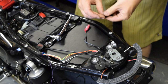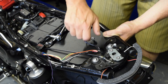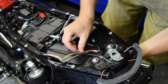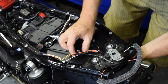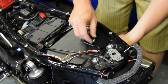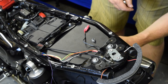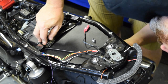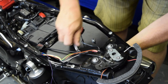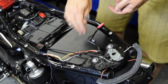These two black Allen bolts go up from underneath, and in the kit there is a nut with a splayed grip washer. These are 4mm Allen bolts as opposed to the Torx star adjusters for the stock bolts. Just give those a little nip up, and there you go — everything nice and tight and fitted.